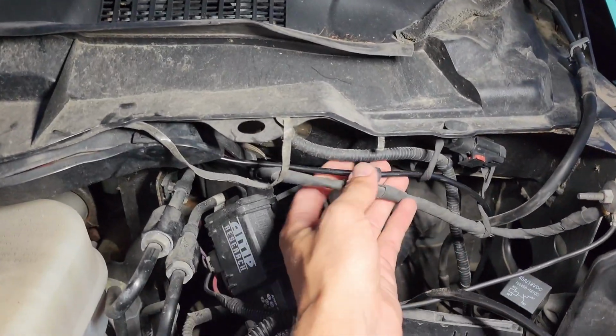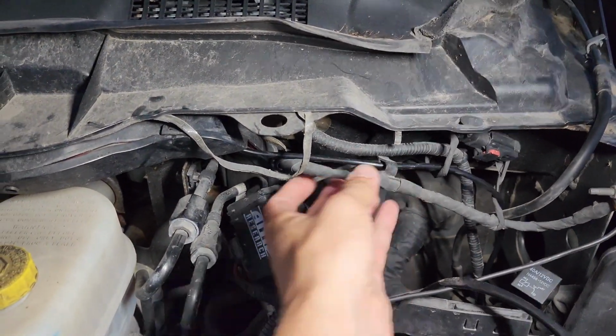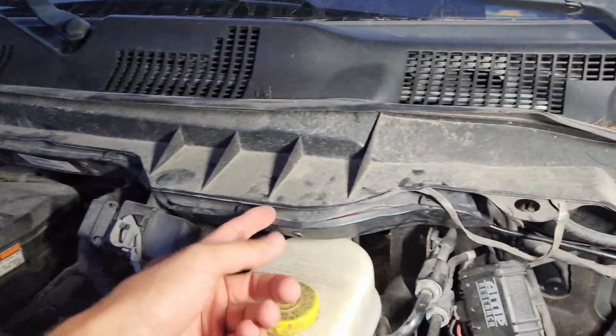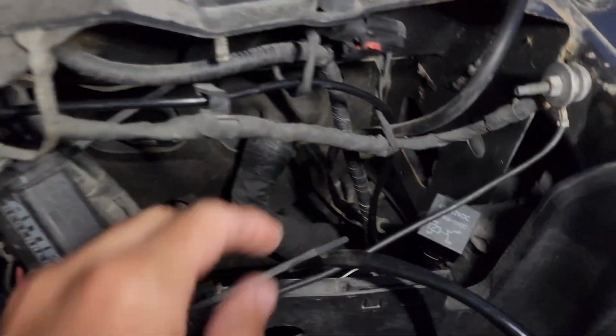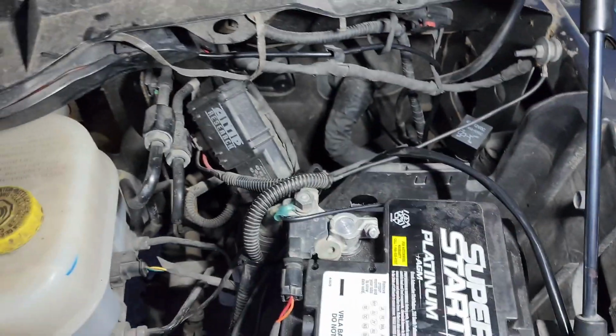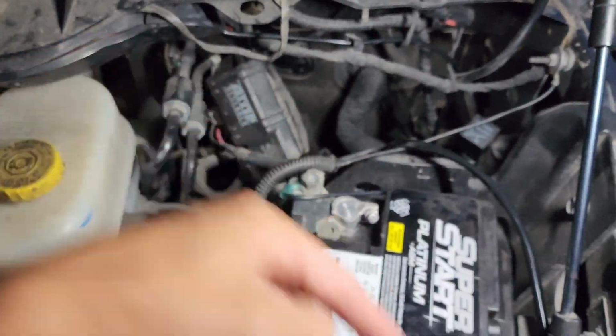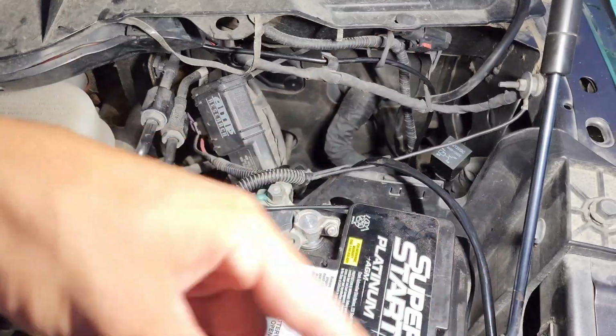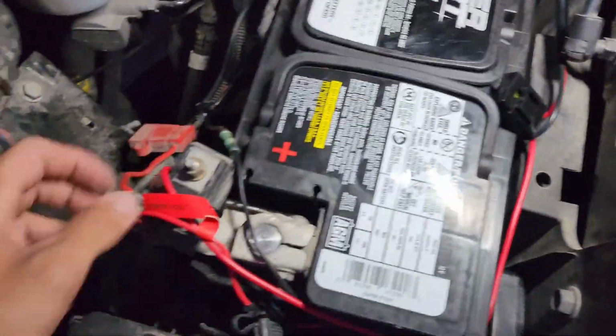You can see right here, all the lights on the passenger side I ran up through here, and I used the factory loom, whatever you want to call it. It comes with a relay and full harness. It comes with 4 legs off of your harness to run. What I used was 1 leg for the front left corner, 1 leg for the front right corner, a couple in between, and then 1 leg for the back corners. So 4 legs kind of do 4 corners of the truck.